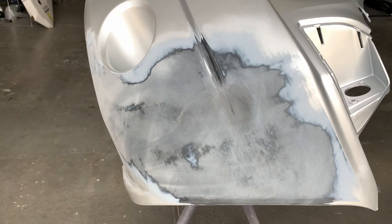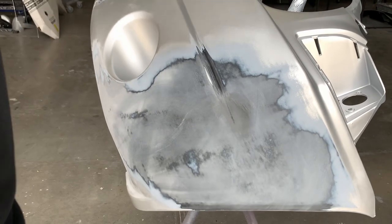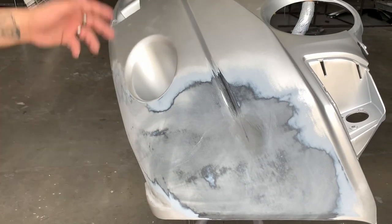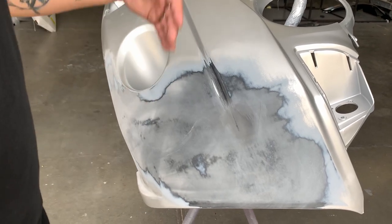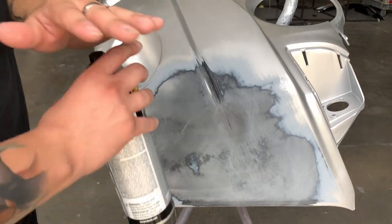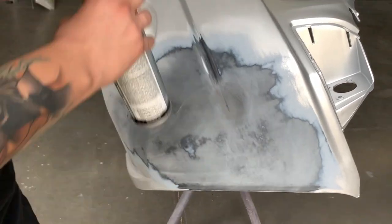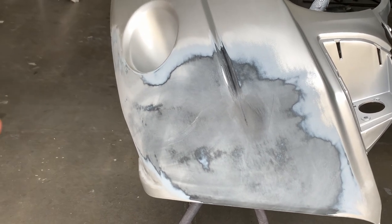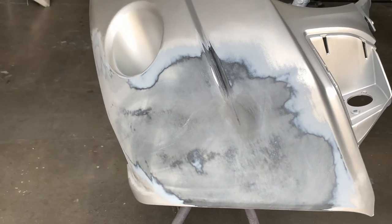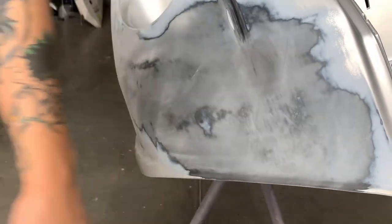So you let it dry an hour and then spray another layer? No — once you prime it one time with a very thin coat, you give it about three or four minutes, not too long. That's only with parts that are already painted. I don't want a reaction, I don't want cracks — because if it cracks, it's going to be a problem. So on this one: light coat, wait three or four minutes, hit it again. The light coats are just going to keep building up, and eventually it'll be completely snow white.